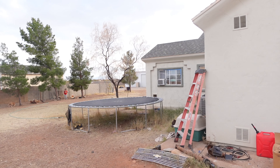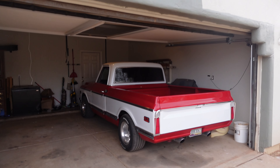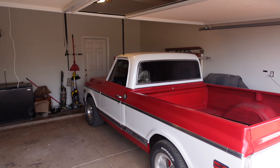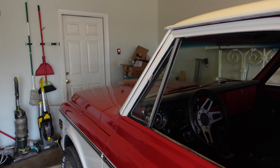What's going on guys — so the last clip I shot I said we couldn't get the truck running. But if you notice, we're not over by the shop — the shop is that direction. And here's the truck. I played around with it a little more; I thought we didn't have spark, but we did have spark. What happened is when I stabbed the distributor I had it off one cylinder. We got that fixed and the truck fired right up.